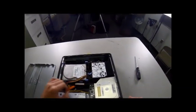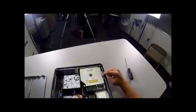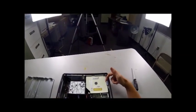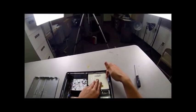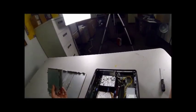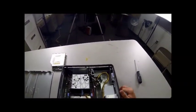Important note: don't grab it from the cables themselves. You want to grab it from this plastic piece right here. Now that that's out of the way, you can actually take the CD out. To remove it, there's this little lever right here, which is marked in blue. Pretty easy to spot. Lift up on it and slide the CD tray back. Set it off to the side. We'll use that again later when putting it back together.